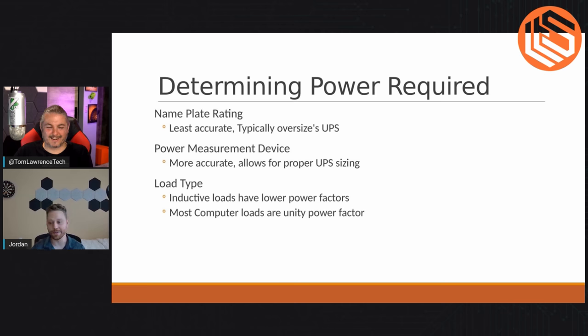If you're taxing that power supply to its fullest, the 1500-watt rating is the output — the input is slightly higher. Modern power supplies are very efficient, maybe 4-5% above the rating on input. In 99% of cases the power supply is oversized to reduce stress and ensure reliability. Stress test it, look at your normal use, and use that to determine the correct UPS size. Many UPSs can also handle peak loads higher than their rating, especially higher-end double conversion or line interactive systems.